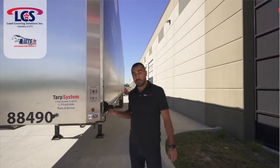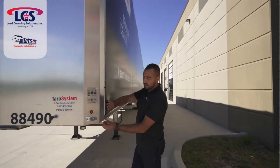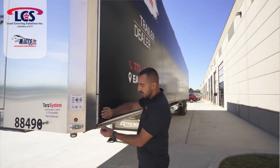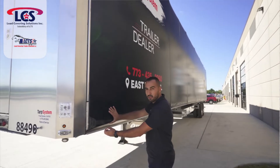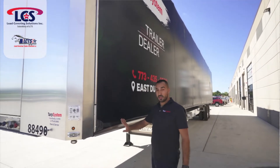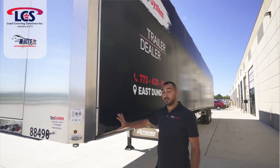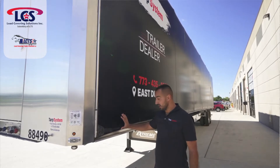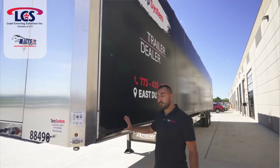Coming to the rail — why this is, in my opinion, one of the best rails. This outside edge here is very strong aluminum and you're not going to be able to bend the track. It's very important when you're on the road and you go to a shipper, they bump into your rail, they can damage your track and you're going to be stuck. You won't be able to push or close the system. With this, it's built stronger, so it is going to protect the track.